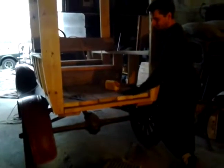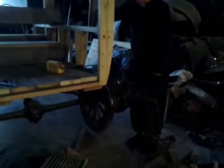We'll come up with something, but I was thinking it would be so cute if we could figure out, show them that cast piece behind you. There's just no way to make stairs out of that. It's plenty ornate, and this is a side to an antique desk at school. The problem is that I can't weld on cast iron and get it strong enough to where you could walk on it. I mean, I can weld it, don't get me wrong, and it'll stay, but as soon as you start walking on it, it's so impure.